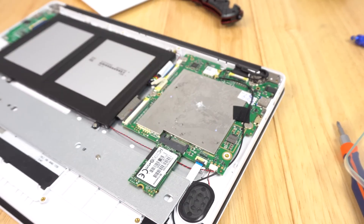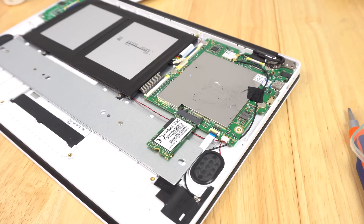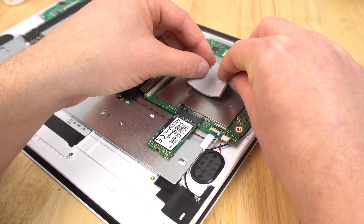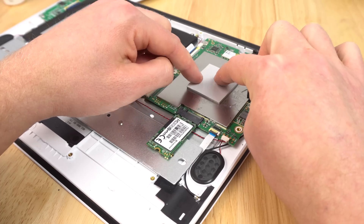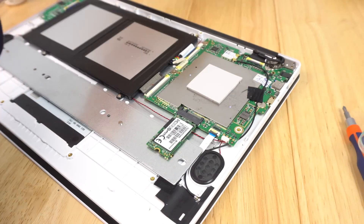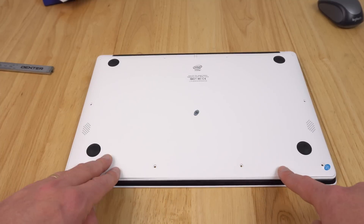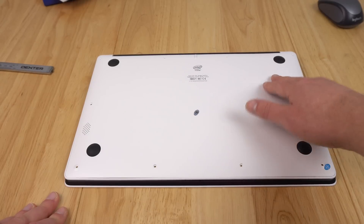I actually found they've got a heat insulator material on the top here — we don't want that, we want to remove it so we can transfer heat onto the back. I got rid of it; it's really hard to get off and it looks a little messy, but I'm not worried since it'll all be hidden. Now I'm going to put a 2mm thick thermal pad here on the top, roughly in the middle where the chipset is. That will then have contact with the foil on the back of the lid, transferring heat onto the rear of the case. Don't forget to plug the battery back in, start clipping from the bottom, and put the screws back in. It fits down perfectly fine with no bulge where the thermal pad is.